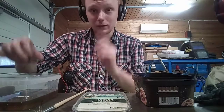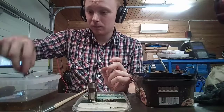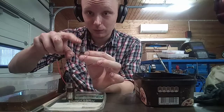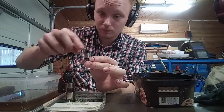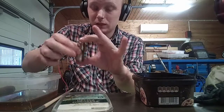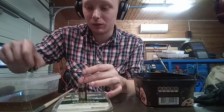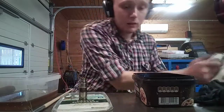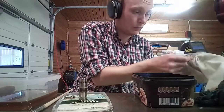Putting them back together: get the outer cylinder good and oily. Then take the piston — I usually have the one-way valve pointed up — then take the spring, put the spring on, and invert it and push it in. That helps keep the spring in place. Then take the cap and put the cap on in the correct orientation, and clean up the clip a bit as well.